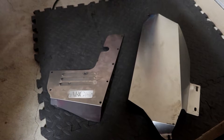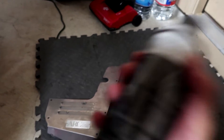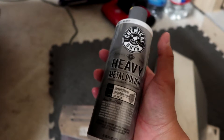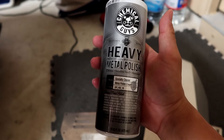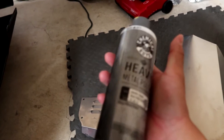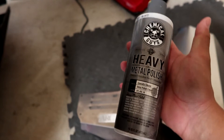After removing all five bolts the two pieces are apart. What I'll be using today is something you can buy off the store — Chemical Guys heavy metal polish. I'm not sponsored or anything, but this is what I have. This works on chrome pieces, stainless steel, and aluminum, so this should work just fine. Shake it up, put it on an applicator pad, and get to buffing. If you have a machine to polish it, even better, but I'm just going to do it by hand.